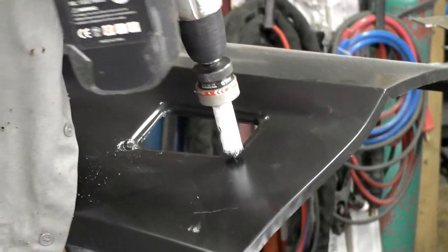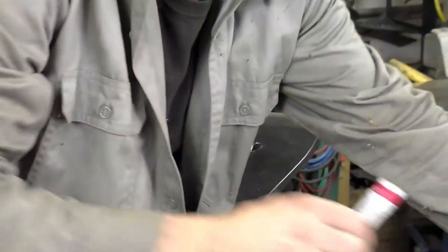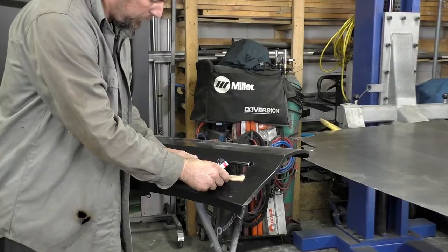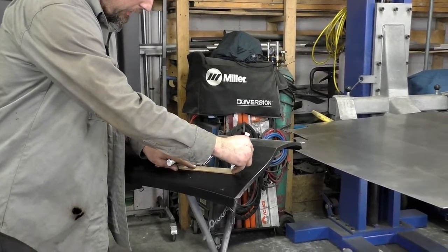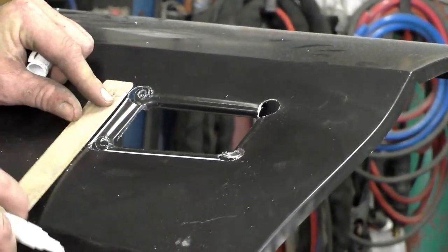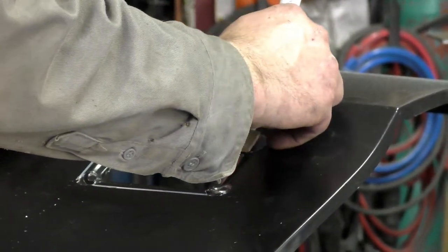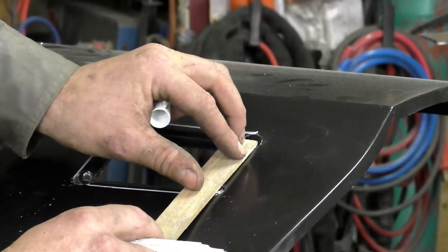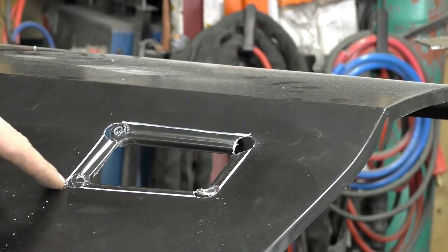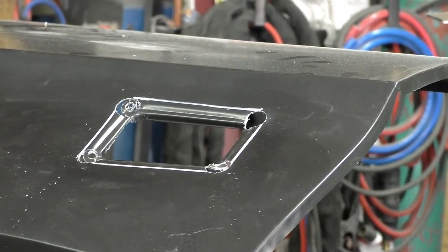We're going to have to go back through and clean all this up. Light pressure on the cut is key to not warping the door panel. Now the idea — we're going to connect the tops of the circles with the cutoff wheel. Basically we're going to cut there, and this doesn't have to be perfectly square. We're kind of rough cutting right now using the paint marker as a reference. That's going to be our cutout, and that's what we're going to use as our basic guide to our curves — that's going to be our patch piece right there.